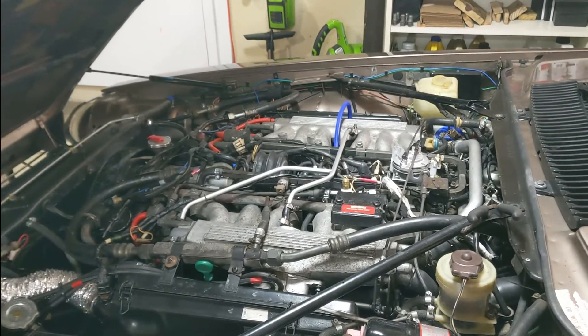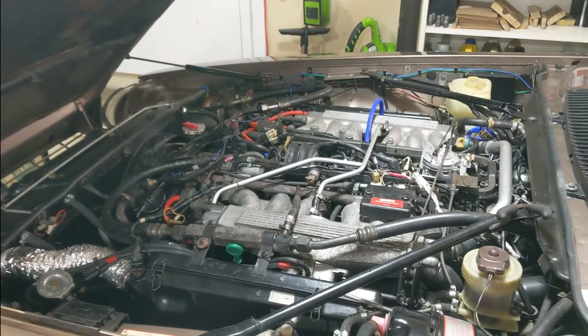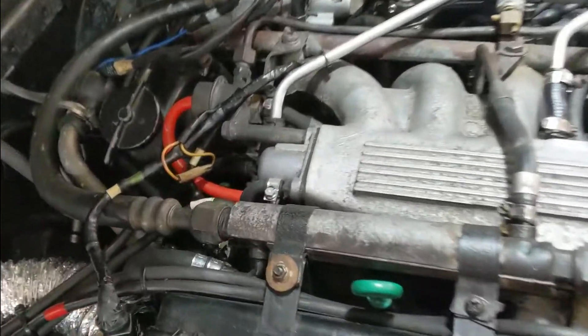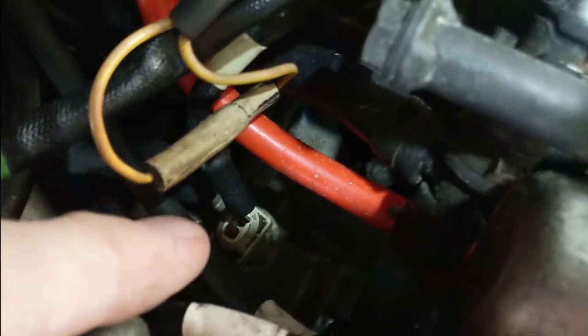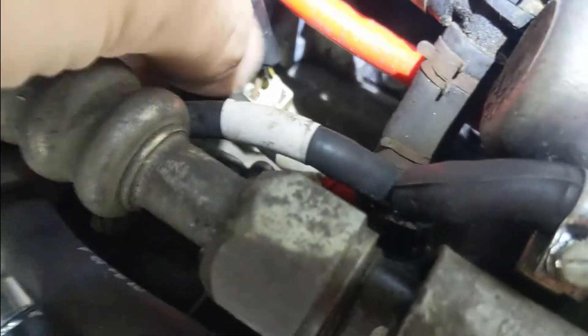The other thing I'm going to do, as people have guided, is check the coolant temperature sensor, because if that's not reading correctly it's going to misdiagnose the amount of fuel that needs to go in. The coolant temperature sensor is right there — that has always been a problem on mine. Let me illuminate that a little bit.